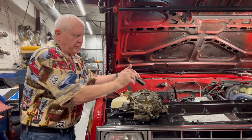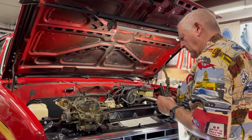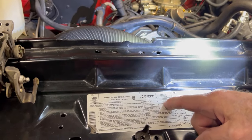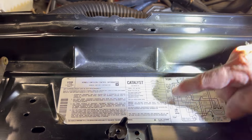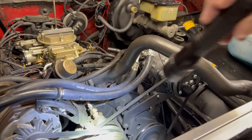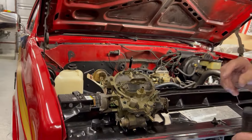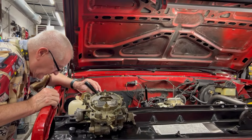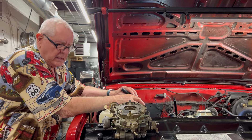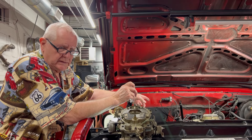The way you set timing is you disconnect the vacuum advance, go over with your timing light and set the timing at six to ten degrees. On this one we're lucky because we still have the specs on the sticker — it shows four degrees at 550 RPM. So you slow the engine down to 550 RPM and put your timing light on it. One bad thing about these vehicles is that the timing pointer sometimes goes missing during the lifetime of the vehicle, and then you're guessing where your timing mark is. If there's no pointer, slow it down until it starts running rough, then increase the timing until it smooths out.